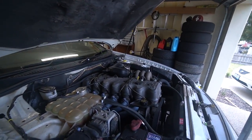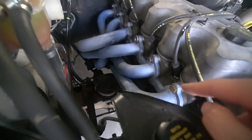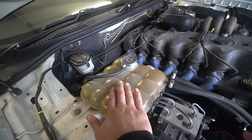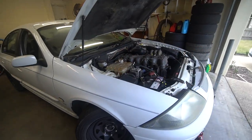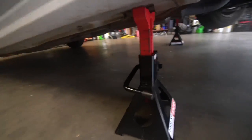It's the next morning now. I made some really good progress — I went pretty hard and didn't record much because I just wanted to get it done. I've put everything back together and the pacemakers have been fully installed with the new hardware. For reference if you want to do this yourself, you're going to have to move a couple things out of the way: this bracket, the throttle cable, and also the steering column. There's a 10mm bolt there and a 10mm bolt just below — make sure you line it all back up. I've got some white pen marker there to make sure I've lined it all up correctly, because you don't want your steering to be all messed up.